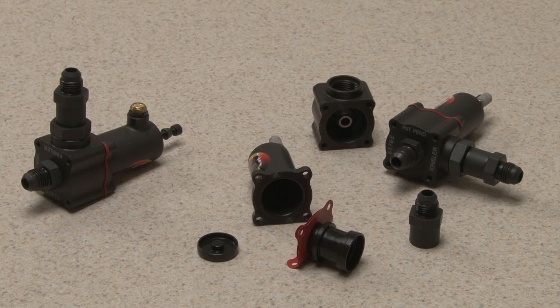The K140 high speed is designed for competition racing and is the most repeatable on the market. It is partially based off the IRL pressure relief valve. It is lightweight and compact, built using aluminum components that are truly hard coat anodized for protection. It has the highest flow capability with the least amount of pressure rise of any valve, and it has many unique features.